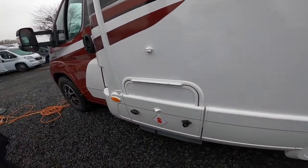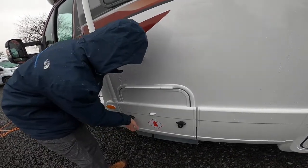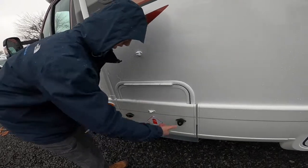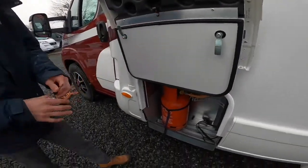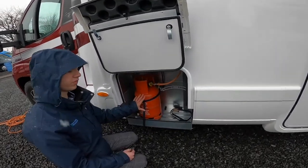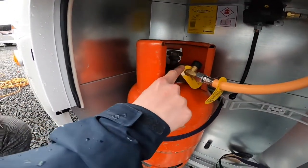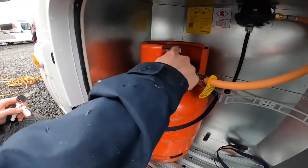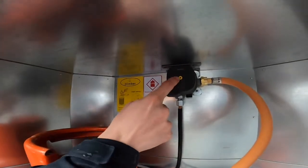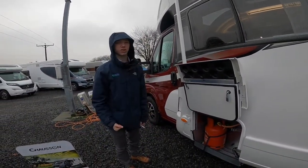At the front here you've got your LPG — liquid petroleum gas. This is the gas locker, which opens with these locks — half a turn of the key and a tap to lock, and then half a turn to release and a full turn of the hand. In here you do have two gas bottles. This slides down to make it easy to get the bottle in and out. Make sure the bottle's securely fastened when within the motorhome. You'll need a gas spanner or an adjustable wrench to attach the pigtail to the bottle — it's a left-hand thread. Nip it up with a spanner, turn on at the bottle, press here which is your regulator and the crash valve that allows the gas into the motorhome. Make sure this little orange tab is pushed in as well, which is the regulator for the motorhome. Obviously turn it off when you are travelling, as it's safer should there be any accidents.